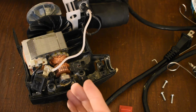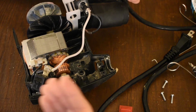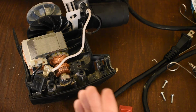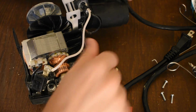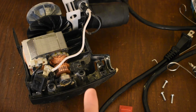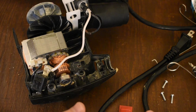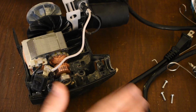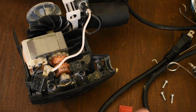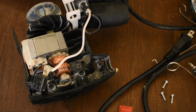They have more loss. Like they're generally less efficient because there's this mechanism called hysteresis loss in the core, which is basically that you pipe the magnetic flux one way through the core, which is this laminated silicon steel here, and then it switches directions within a 60th of a second, and it tries to pipe the magnetic field the other way, and the material here that the field is going through doesn't like having the direction switched. And there's some energy loss associated with that. That is lost in the form of heat, as energy is typically lost, and so it heats up.